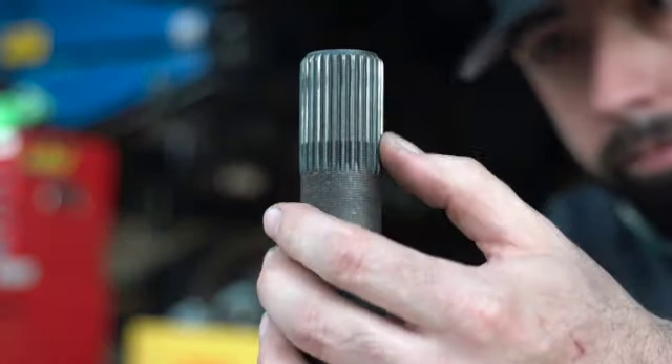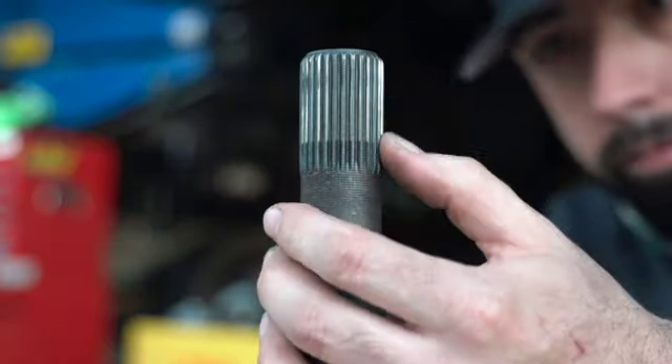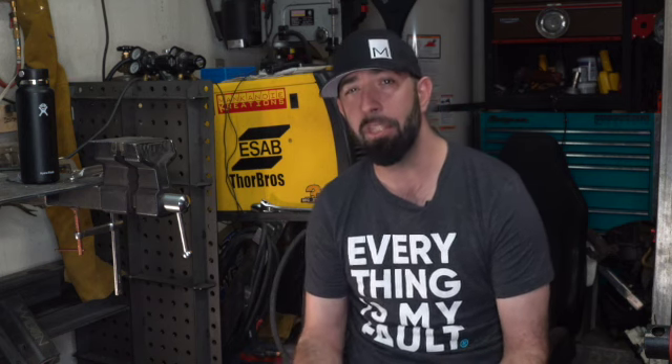I'm unsure if they would modify a Mitsubishi Axle, but let's assume for a moment that they would. Here's what you need to pay attention to. If you look at the splines at the inner end of the axle shaft, you'll be able to see that only a section of the splines is used. The shiny section is where the axle splines contact the splines inside the differential. There's a line where the shine stops, and an unused portion of the splines is left. This means that you could essentially push this axle in a bit and therefore narrow the axle. All you need to do is cut the excess off the end and remove that same amount from the axle tube. It looks like there's about a quarter inch of unused spline — a whole quarter inch. I don't know how much extra fender room you need, but I can't see myself doing that much work just to gain a quarter inch of clearance on each side.